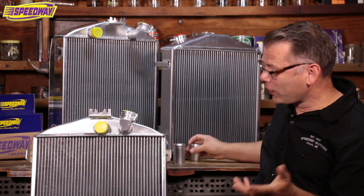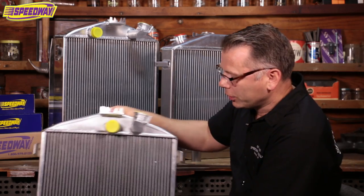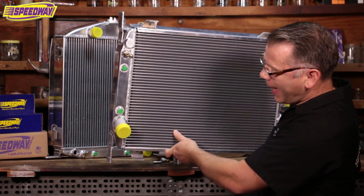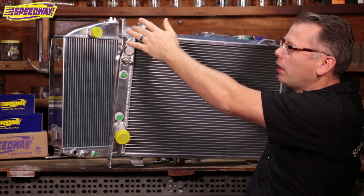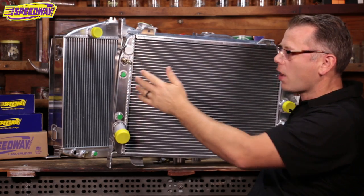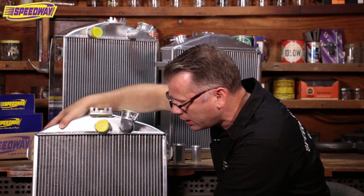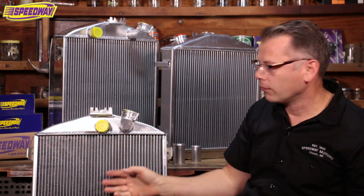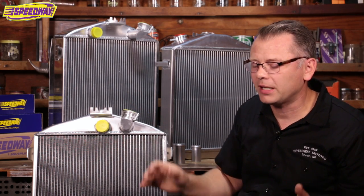My radiator's all ready to go. The other thing I like about this radiator — if you want to get into manipulating it, and of course a lot of guys just want to bolt it in and go — on my little Roadster I wanted to run a stock height radiator, but I needed it lowered just a little bit in the car to make the hood nice and level. What I was able to do is take these aluminum mounting tabs, cut them and lower them without taking them completely off the tank and re-welding them, and I got a good inch lower radiator. It still fit nicely in my Model A crossmember. A lot of guys ask: 'I want to run this with a Model A Roadster body, but I don't know if I can fit a stock height 27-inch radiator.' Lowering those tabs just a little bit is one way to get that clearance.